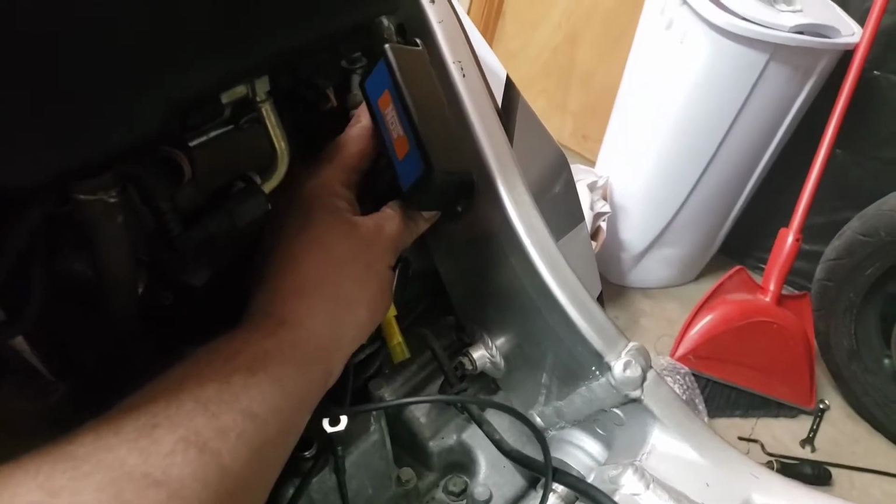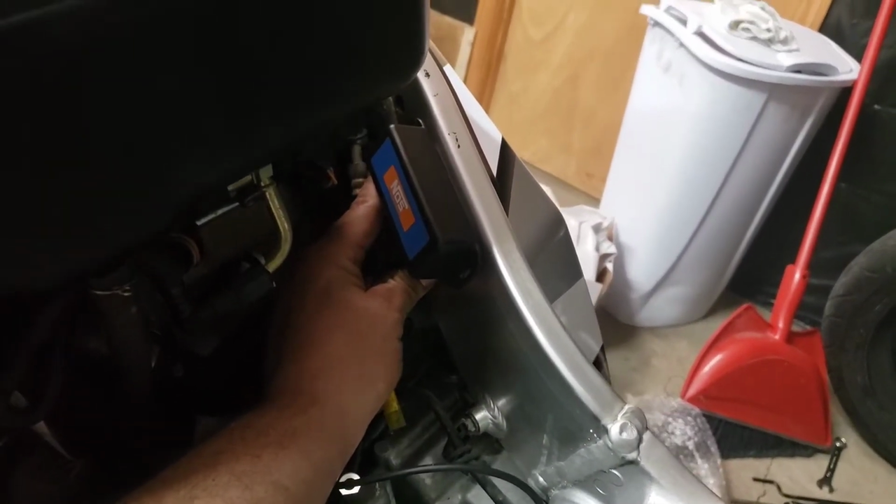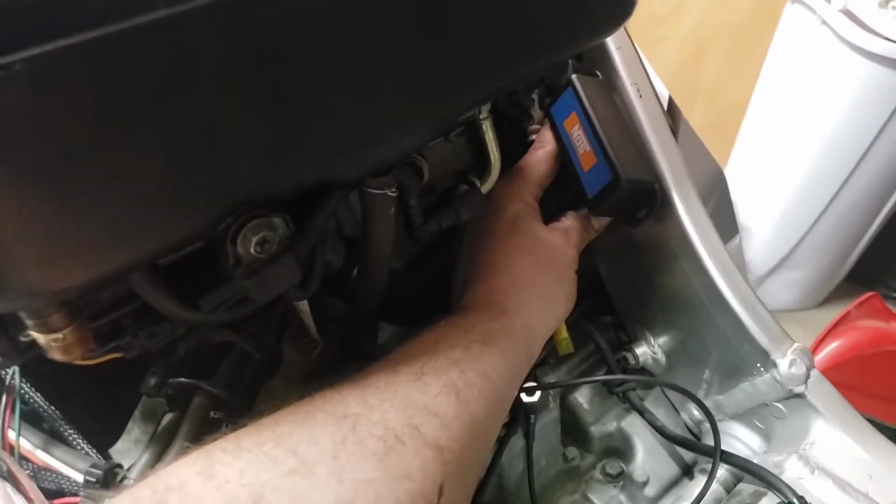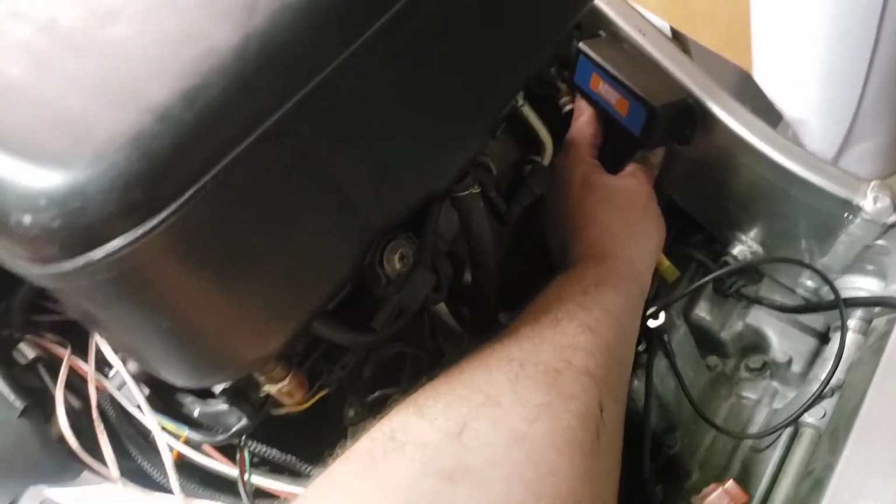All right guys, so my battery's dying, but I have settled on right here for the location for the controller. So hopefully that works out pretty slick. It makes all the connections real nice and short and neat and tidy. I only have one connection going to the front for engine RPM, but I should be able to tie that in back here at the ECU, make that a whole lot easier. We'll do a plug and play connection there.